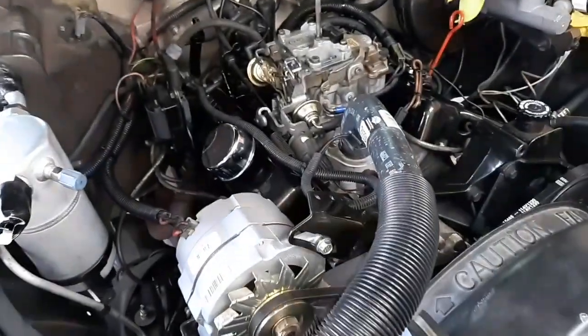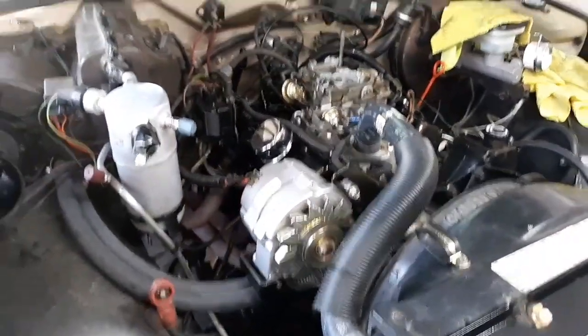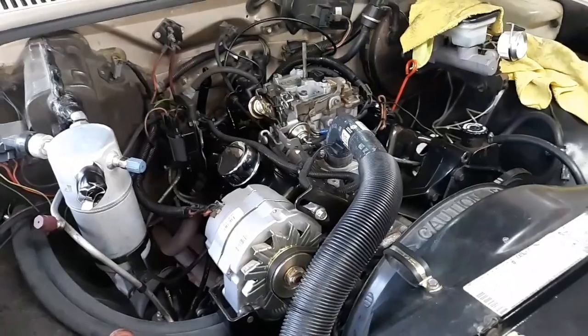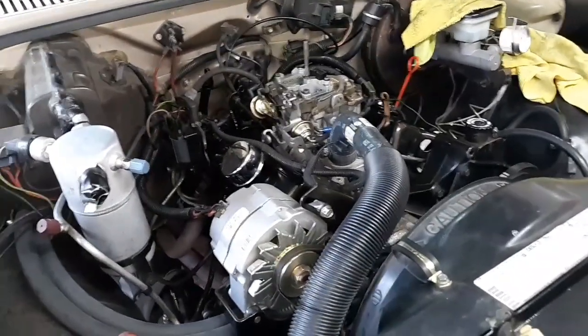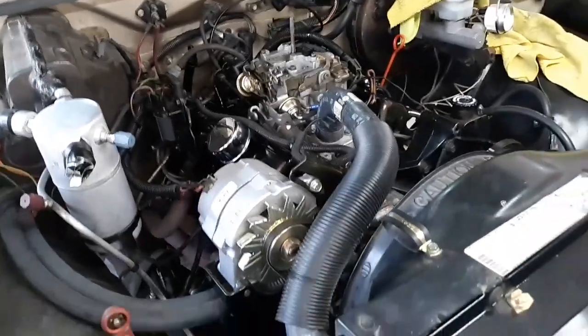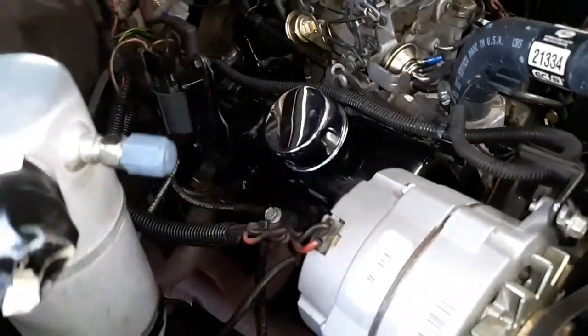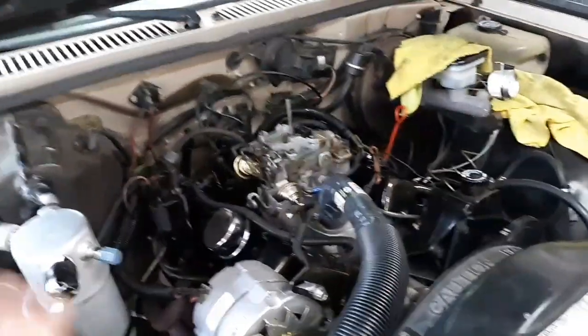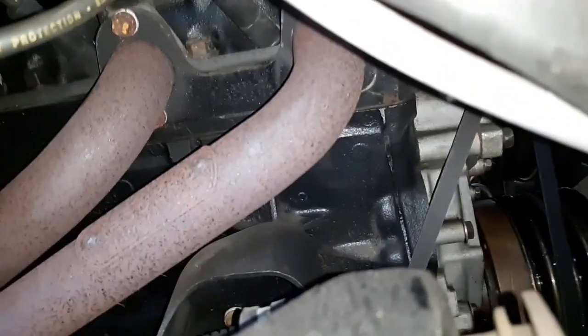So now you've seen the oil change video, you can kind of see how nasty and milky the oil really was. And also the bore scope in each one of the cylinders. I still think that it's been bored over 10. I still believe this is a crate motor because it still has that black colored finish. And it's not like something from a spray paint from a regular person spray painting it. As you can see what I'm talking about.